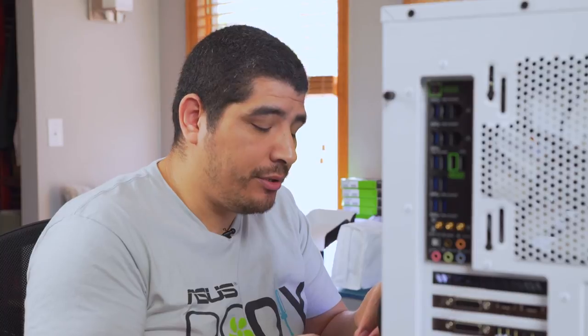So the CPU architecture compared to one, this is the brand new generation. This is the Haswell-E. So it features faster architecture, just clock to clock. There's more cores, there's more cache. Overall, it's a superior CPU compared to any CPU you can put in the Mac Pro. The next front is that the Mac Pro doesn't offer DDR4. So this offers DDR4 capabilities, which offers superior bandwidth and superior performance.